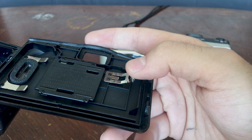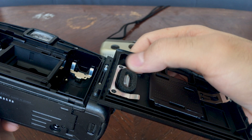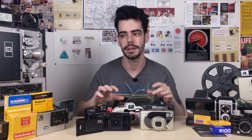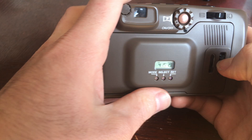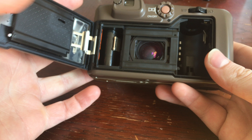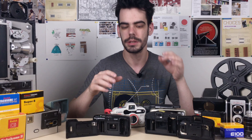It's a good idea to thoroughly inspect the camera when you're looking to buy one. Pop open the film compartment door and take a look inside. You want to make sure there's no visible damage to the back of the lens, and you really want to make sure the pressure plate is there, because in these point-and-shoot cameras those pieces are just plastic and easy to lose. The film compartment is also where you find your DX code pins — a series of contact pins that tell your camera what film ISO you're putting in, so it can auto-expose the film correctly. More pins in the film compartment means a wider number of films it can auto-detect, which gives you a better idea of how versatile the camera will be, especially if you like to shoot a wide variety of film stocks.